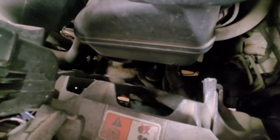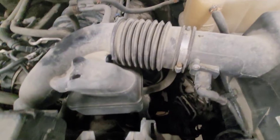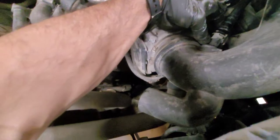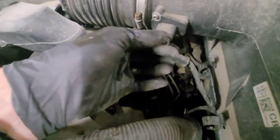The oil filter on these trucks is located right down here, and there's a little funnel that's supposed to drain the excess oil into the pan. I've set up my catch pan below. To make more access to this, I'm going to remove the top of the airbox and intake. To do that, I need to remove this screw, loosen the clamp, and pop this clip loose like that.